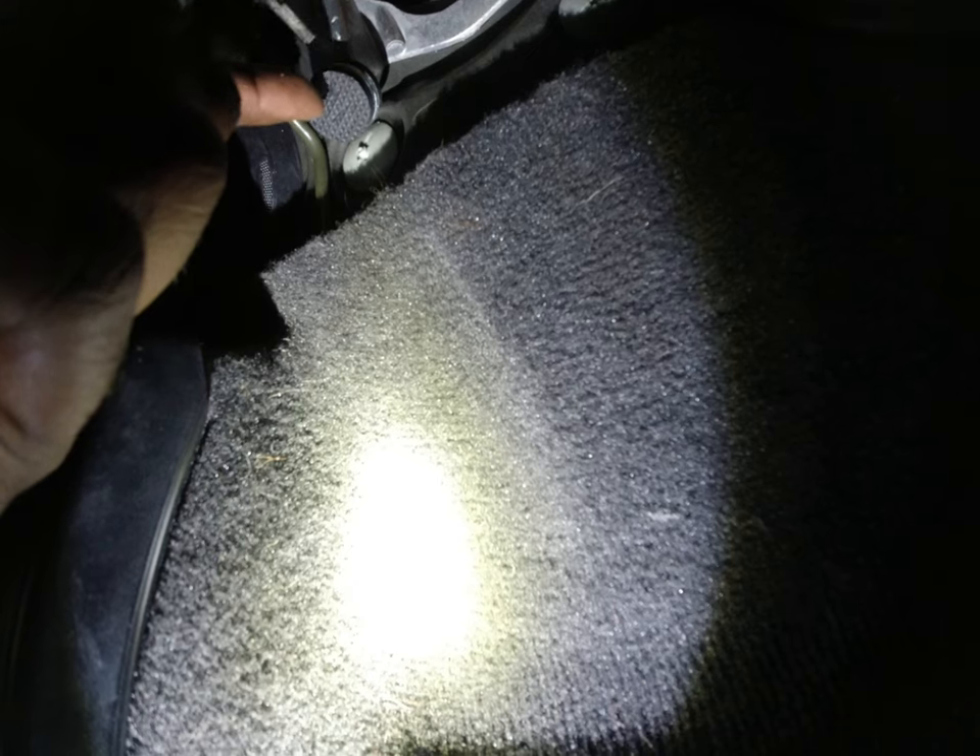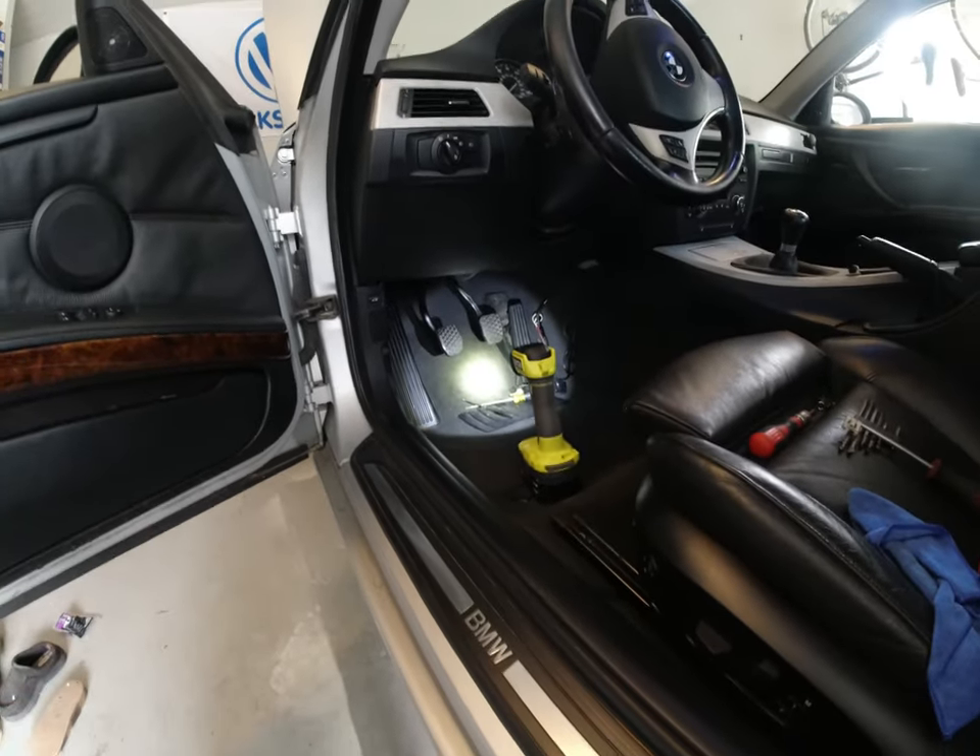Put the spring on and that's it. There's a bump stop here that actually came with the car, so I'll leave that. But if you don't have one, go ahead and use the one that comes with the package for the ultimate clutch pedal set. When you're done, test it out — push the clutch all the way in to make sure it makes contact, and test if you can start the car. If it's too far up, the switch by the clutch pedal won't activate to allow the car to start, since you need the clutch down to start.